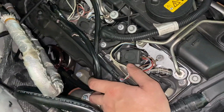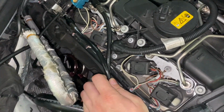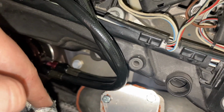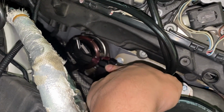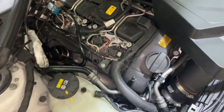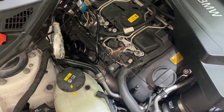My wastegate is being controlled by this solenoid, and it has all the lines in braided stainless steel. So it's nearly impossible for it to fail at just 30 pounds of pressure. These lines are built for brake use, so they actually handle like 2,000, 3,000 PSI of pressure. So at 30 PSI, it's not going to fail. They're stainless steel, so you're not going to have them break or explode, and it's an AN fitting, so it's -4 AN. It's not going to blow off the fittings. I also just capped off my blow valve, the factory diverter valve, and I'm running an external mechanical blow valve on it, so I'm not using the factory style diverter valve.